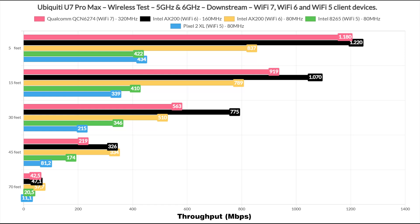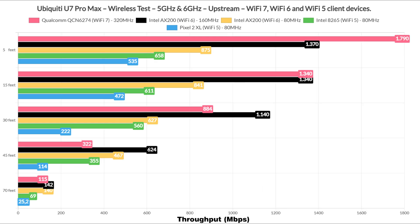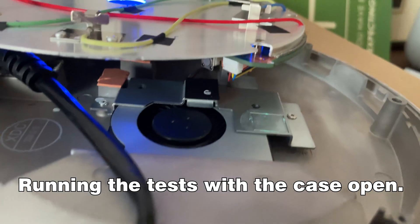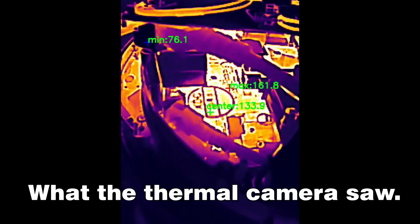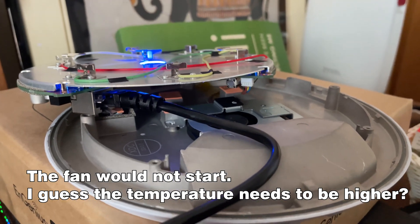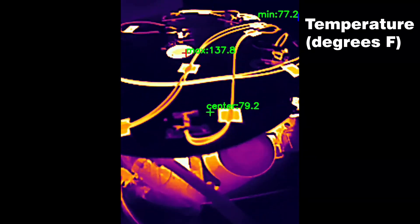As you can see from the graph, the downstream performance is so much better than on the U7 Pro, especially when using the 6GHz network. I also saw it perform a bit better upstream as well, but I do need to mention some strange occurrences. After running the test for a few hours, I did see that the 6GHz throughput would begin to fluctuate, sometimes staying below 1 gigabit per second. After letting the case cool down a bit, everything went back to normal. It is possible that I experienced some thermal throttling, but Windows 11, the WiFi 7 adapters, the clients, and even interference could have been a factor.